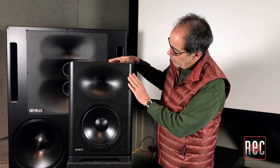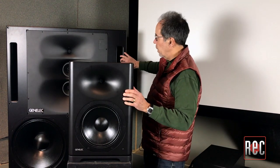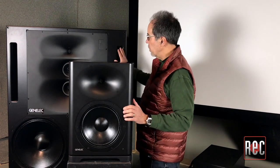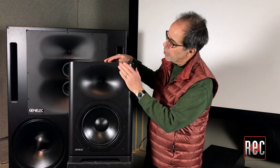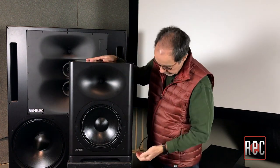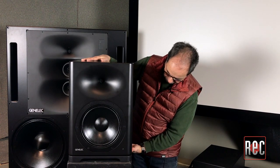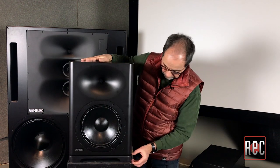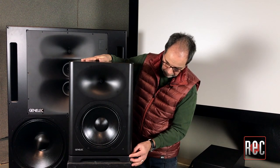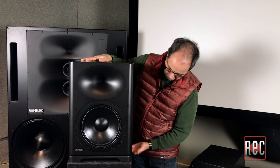Speaking of bass, I noticed that there are no noticeable bass ports on the S360. Well, that's kind of unique here. If you look at the front baffle, you can see the absence of any typical ports like you might see on these big 12-36s back here. The rest of our Master Series also has ports on the front baffle, but these have very large waveguides. In order to get as much geometry as possible for this extended waveguide, we needed to move the ports. They're not on the back — they are underneath. Those ports actually slot down from the inside and empty out on the bottom, one on each side, with enough clearance from the isoplate so that airflow is unrestricted.